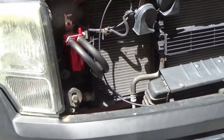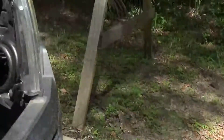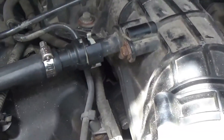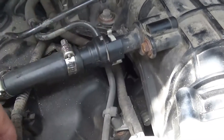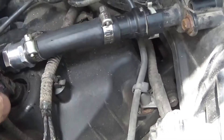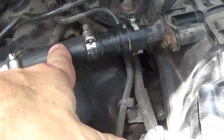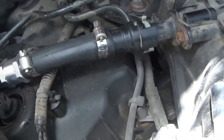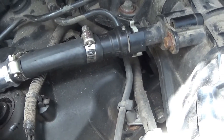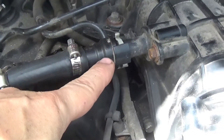The system's in. There's your left catch can and your right catch can. Here's your intake — this comes out of the left catch can and goes into the intake. There's a one-way valve right here with a little arrow pointing that way, which stops the back pressure from the intake during turbo from pushing back through. You need a one-way valve. This is half-inch inner diameter fuel hose — I bought a roll on Amazon, AC Delco, which was cheaper than buying it per foot. I used approximately 16 feet of hose total.